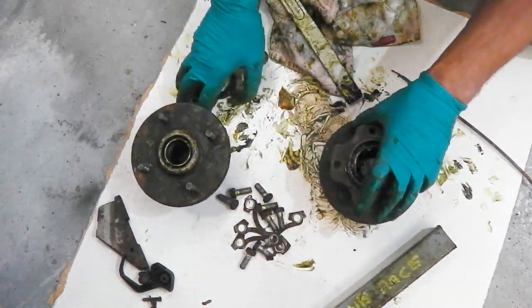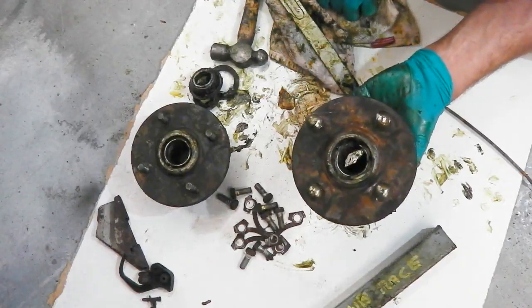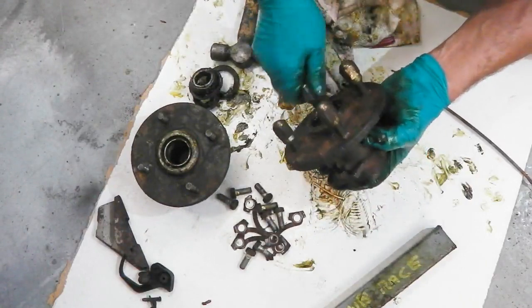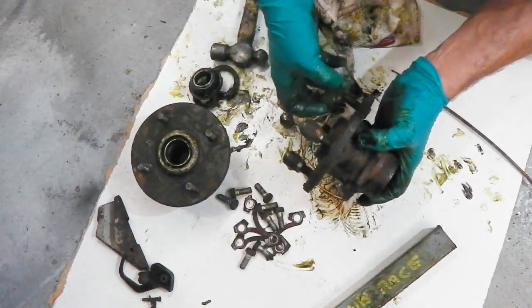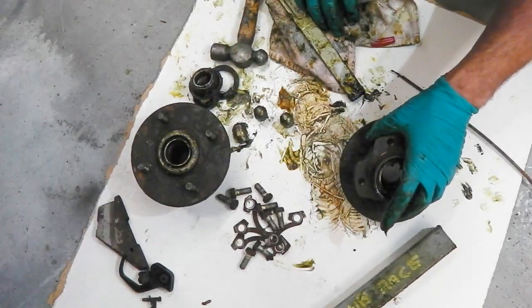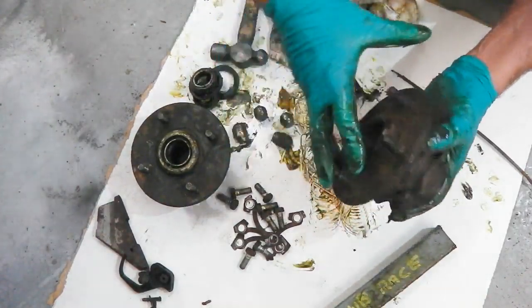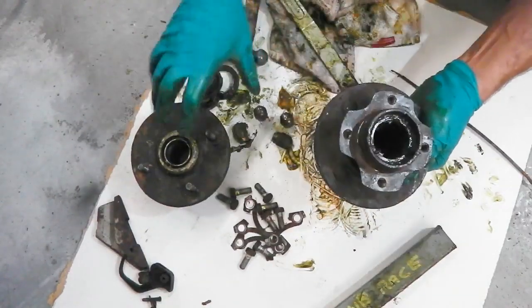So now, obviously these need cleaning up, there's a lot of grease in them. We need to really wash these in some thinners to get rid of that grease. These need a degrease before, we don't want to insult the galvanizers. They're very nice people down there. I like to make their life easy. To make their life easy, I take everything nice and clean, which is why we're going to be using the parts tumbler soon. We'll be getting that out of the bag.